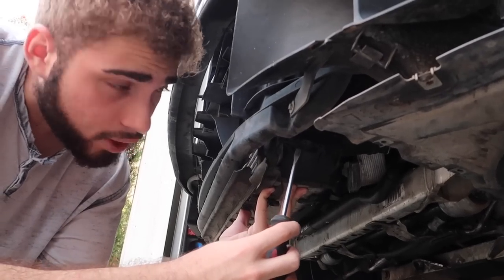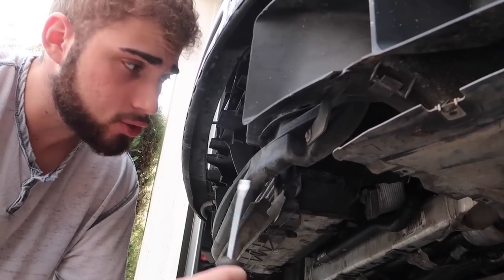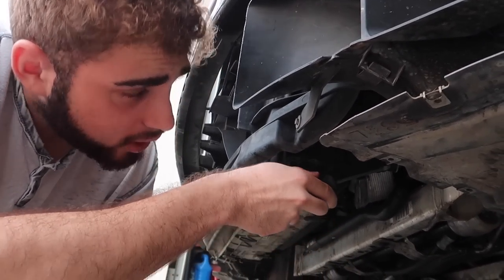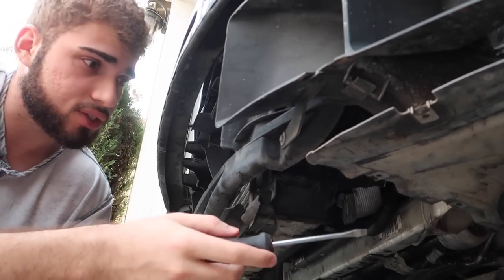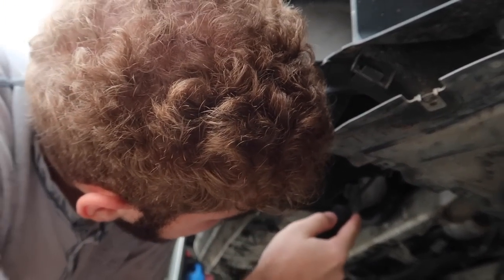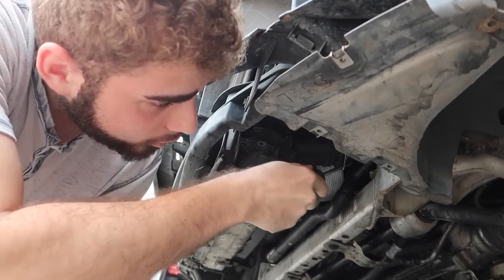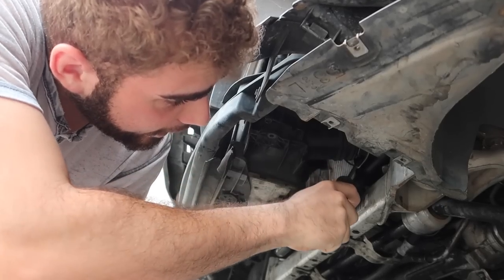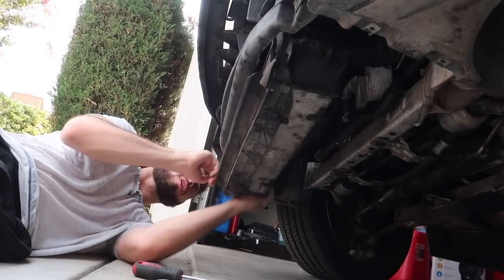There should be one screw on each side — I actually don't have all the screws, so I moved the one screw from both sides. There are just two clips holding the intercooler, plus the charge pipe on the other side. We're going to release the charge pipe right here — this is technically going to be replaced with the J-pipe. We'll disconnect that side and this side as well, and then we should be able to drop this whole thing.